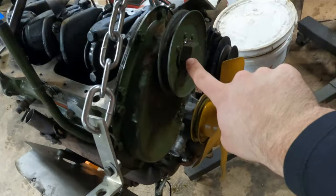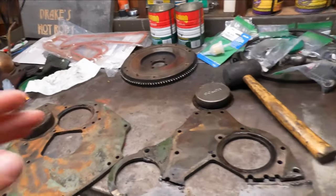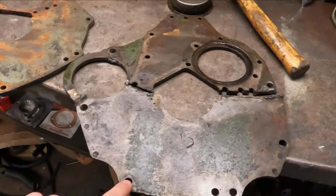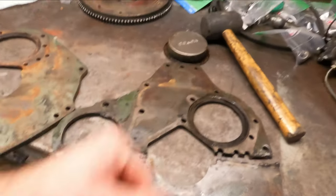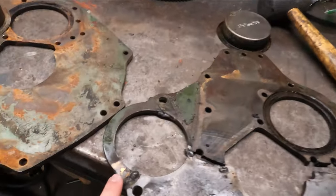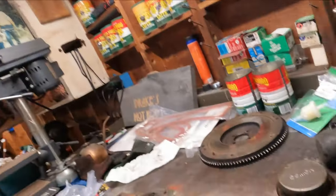And obviously that's a big bolt on there. I had a breaker bar on the other side, and I had my engine stand points to lift pretty spread out on this thing. I think I was down low here, there, and then up top. Unfortunately that put a ton of stress on this plate, and somebody had actually brazed it back together before. You can see where I tried to weld it, which ended up just being a foolish idea, but it completely cracked on those brazes. I was like, oh my God, what was that noise? And then I saw the engine was tilting down.